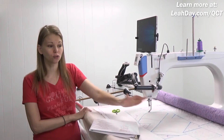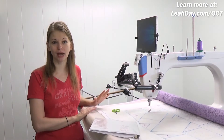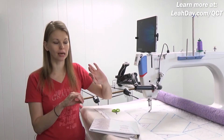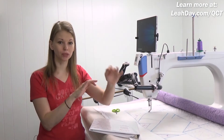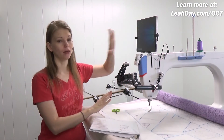Unfortunately, I did not do that troubleshooting before I turned on the software — I turned on the software first. So the very first square I stitched out, it started to skip. The motor doesn't know that. I'm seeing it on the machine going, wait, what's going on? Why did the thread just break? Why did that just skip? It was a pattern that goes over that spot multiple times, so the first time it just broke thread. The second time the needle hesitated to go up, but the carriage kept moving and it snapped the needle clean off. I could have avoided that whole nine yards had I done my troubleshooting — just me and the machine moving, not the software.